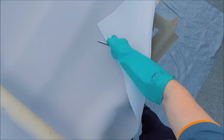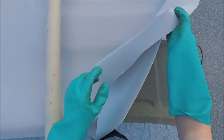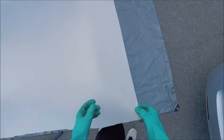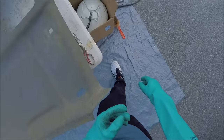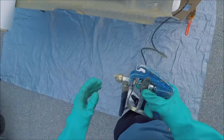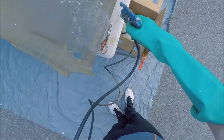Here we grab a cylinder rod so we can bend that fabric over 50%, which prevents us from getting a harsh crease line in the material. But if you do get any imperfections and creases, don't stress — just reinstall it back in the car and after a few days of the car warming up, any imperfections and creases will dissolve themselves out.